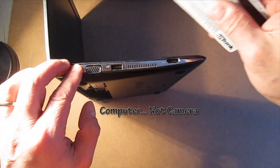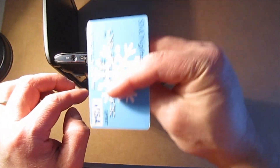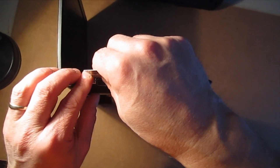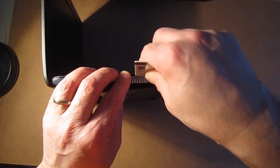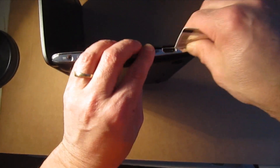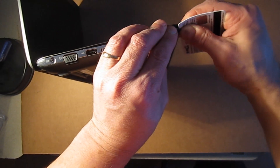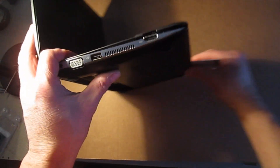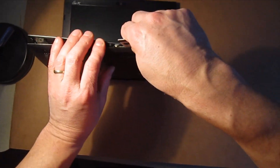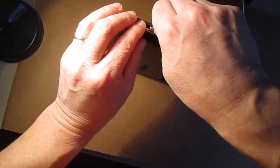What you want to do is flip the machine up on its edge — you've already removed the screws. Take a credit card, a gift card or something, and this is one of those things that you want to be a little bit cautious with because you don't want to break the plastic tabs. Basically you pry the card in there and give it a twist. On the front you don't have to be so cautious, but on the sides if you push too much pressure in you'll break the tabs off.